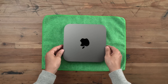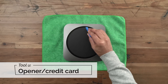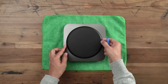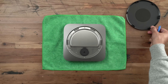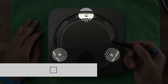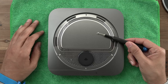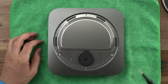Make sure you have a soft surface to flip your Mac Mini around. Make sure the ports are facing you and you can read the Mac Mini logo. Take an opener or a credit card and simply pry open the plastic back cover — that's super easy to remove. The little black antenna should be closest to you. Now it's time to remove the six security screws. We'll start with these three first because they are a different length than the other three, using a TR6 Torx driver. Make sure you place them in an area where you can keep them separate so you know which screws go where.